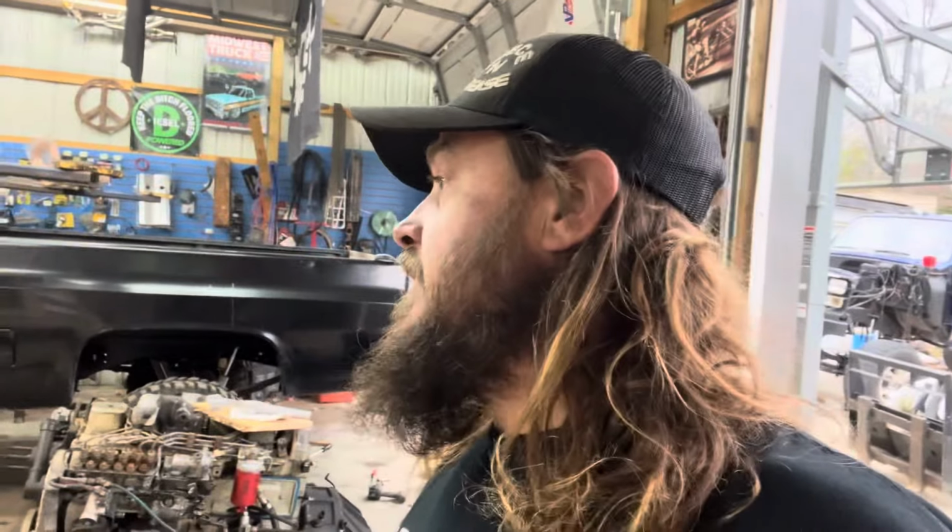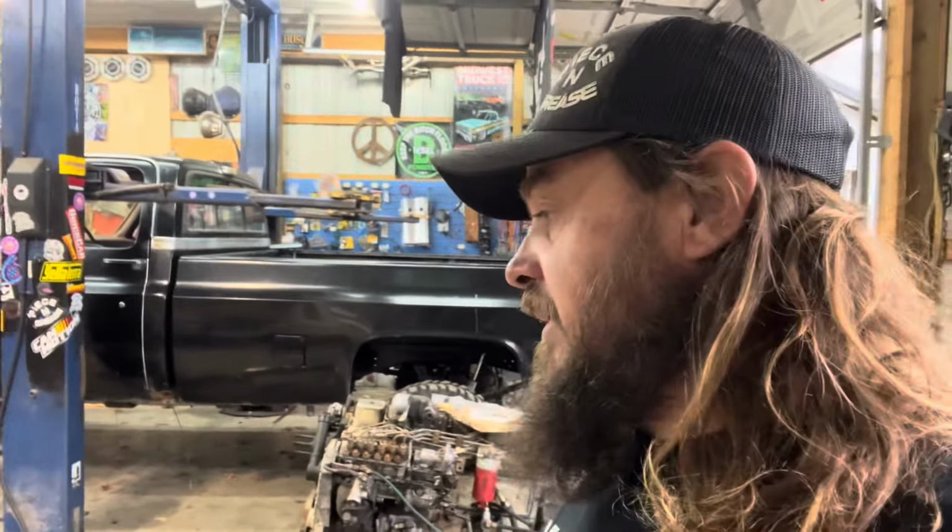All right. Quick axle differential investigation reveals 3.73, actually. 3.73. What that means is don't go bigger than a 33. It's a 4-speed, so we need to keep more low RPM grunt, which means we don't want to throw a top-end cam or a top-end LS in it. That'd be good axles for a big block, good axles for a young man, good axles for a stock small block Chevy with a cast iron intake and a 4-barrel. That's all we're going for on this.